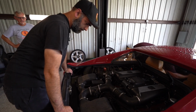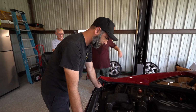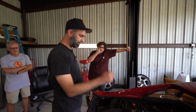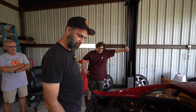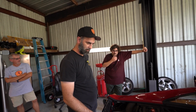Yeah, we're gonna have to do some mechanical evaluations. Well, not mechanical, but manual evaluations for sure. Might as well do the compression and leak down test now that it's warm. We'll do that next, and then we'll open up the ECU and get to the harness and start pinning out all the engine sensors. See what we can find pinned out incorrectly. Because we had some lambda sensor faults, we had a water temperature sensor fault, we had a few things.